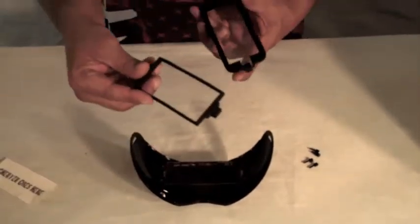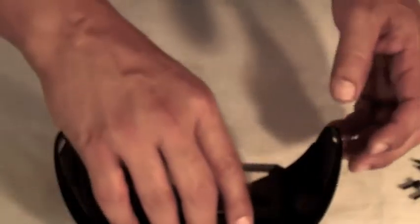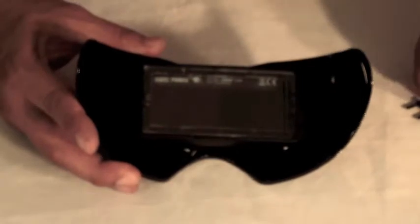Now this gasket here is really important. It can only fit in there one way, into the backside of it, just like that, just for extra light blockage. Also a cushion for the ADF — when you drop it, it gives a little cushion. So what you want to do is stick that on there just like that. And then the screws.